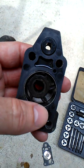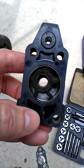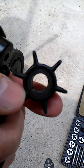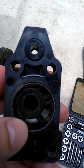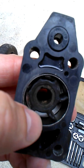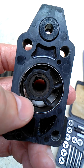The only reason I say to pay attention is because when you buy the new impeller — and for those who don't know, this is my first time doing this, so I'm just trying to make it easier for the next guy who tries to do the same thing — the fins are actually straight on the new one. But once they're inserted into the housing inside the little metal cup, they take the form of the way the drive shaft spins. So you can make sure to see how that goes — it's gonna make it a lot easier when you put that back in, because you're gonna have to twist the drive shaft in that direction to make those fins fit.